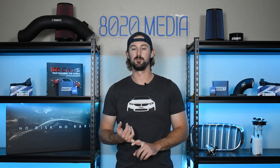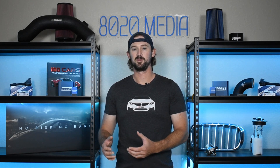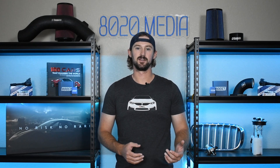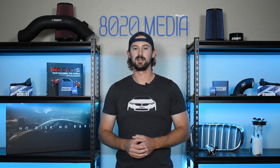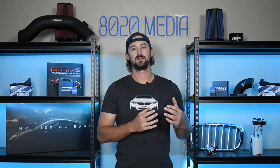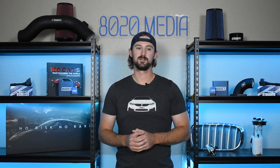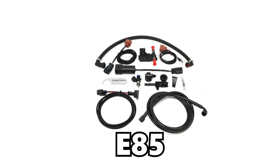Let's talk a little bit about fueling, because fueling is something that is good to run even if you're just tuned with full bolt-ons — at 475 to 500 wheel horsepower, you're going to be maxing out your stock fueling. The high pressure fuel pump and the low pressure fuel pump are both limiting factors on the Stinger 3.3-liter. The best setup is going to be running 100% E85 with an upgraded high pressure and low pressure fuel pump, which is the ideal setup if you're planning on upgrading turbochargers and shooting for upwards of 600-plus wheel horsepower. For a more modest upgrade, the best route is charge pipe injection running E85 or ethanol blends.